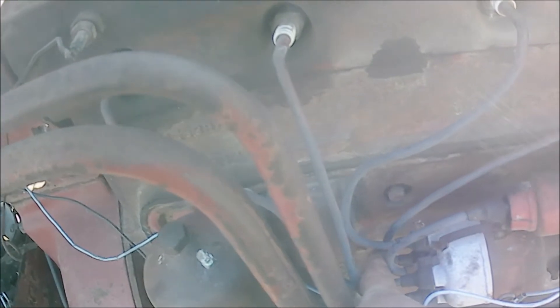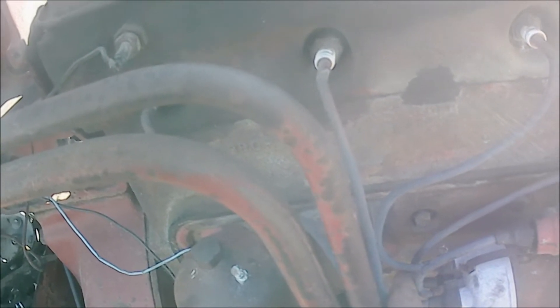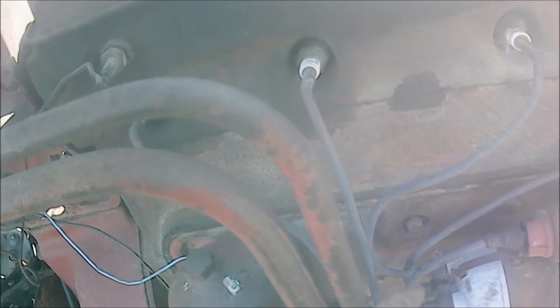I put the wires on wrong for a reason — this is the way the wires were. This is number one, this is number three, this is number four, and this is number two. Now, there's gearing inside the distributor that turns the distributor the opposite direction, so it turns clockwise on each end because of the gears in it, and this should be the number one terminal.